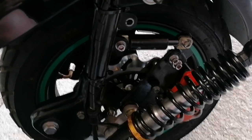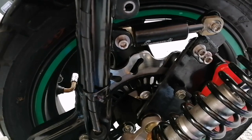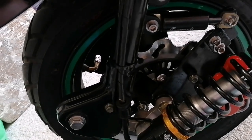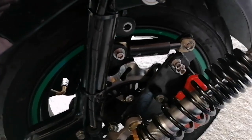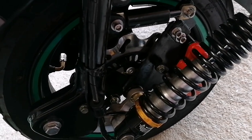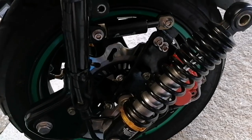Hi guys, as you can see, I moved that bracket, or my welder moved that bracket down to that one. And what we're doing, the point of it all, is to get it all symmetrically correct. Because with these dampers, I don't wish to be controversial, but it all seems to work against itself how it was, and the front end's so stiff on these. And what this has done is we moved that bracket down, and look, as you can see, it's all symmetrical now.